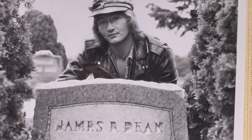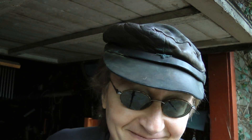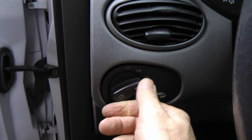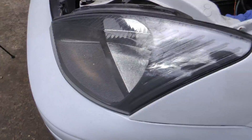When I was young and dinosaurs roamed the earth — yes, that is an old picture of me, I've still got the hat — cars were much simpler and didn't use relays. It used to be that when you turned a headlight switch on, electrical power went from the battery to the switch, then the power went from the switch out to the headlights to turn them on. But of course that's far too simple for modern cars, and it costs too much money to make strong switches that can hold all that power.